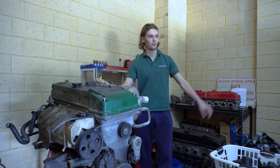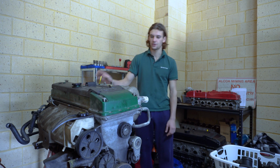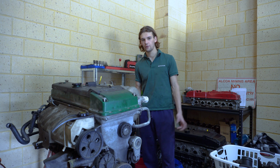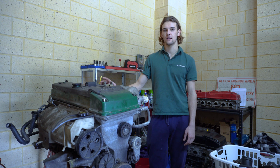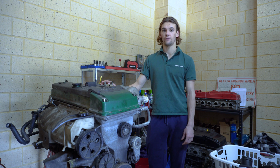We've rebuilt the BA motor which is in the car currently, and that motor will be running a sub 10 psi 98 and E85 flex fuel setup prior to installing this motor. So this motor is going to be getting a full overhaul, so head, lower assembly, pistons, rods, everything will come off. The only thing we're going to leave together is the rods and the pistons, as they're a press fit gudgeon pin, unlike the turbos which have a full floating pin. So we'll be tearing this down today and getting it ready to be hot washed and ultrasonic. Although I have taken the rocker cover and dropped the sump off it, and it is looking very good.